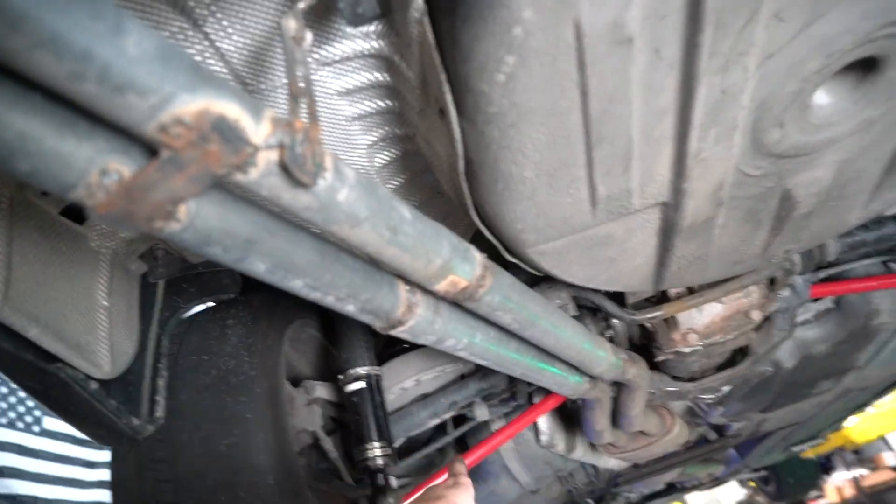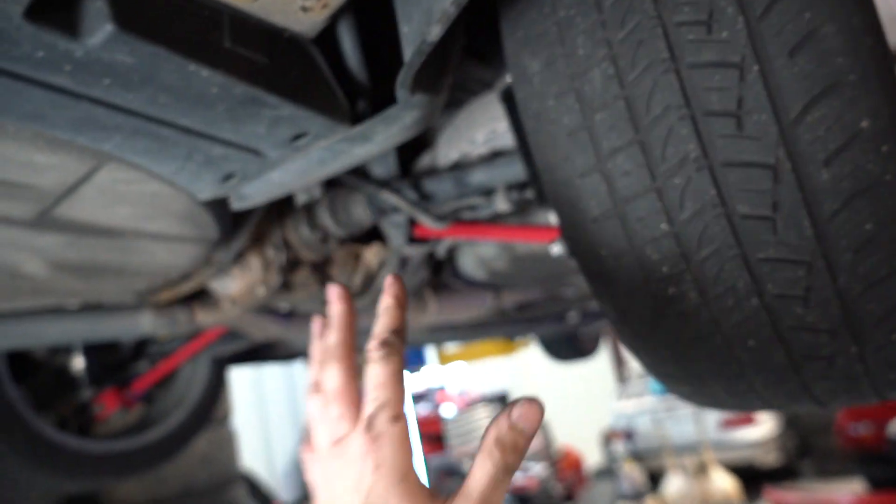A little bit of prying and finessing and she's out. New camber arm going in — just like that, all wrapped up and everything installed. That driver's side was more of a pain, so keep that in mind. One thing you'll definitely want to do after this on your E46 is get an alignment — nothing beats an alignment rack and machine, though I might just eyeball it since it's a drift car and I have an event in a few days. Overall this is going to solve my camber issues. Shout out to Max Speeding Rods — I'll leave a link in the description. Make sure to like and subscribe, we have a lot of E46 content coming!